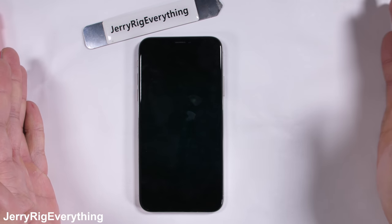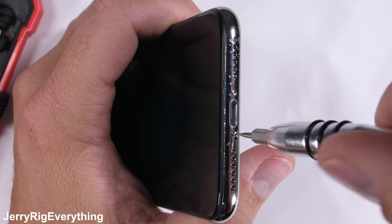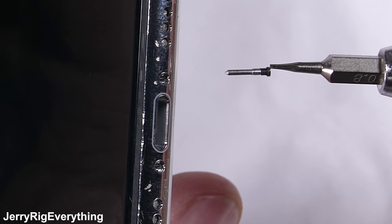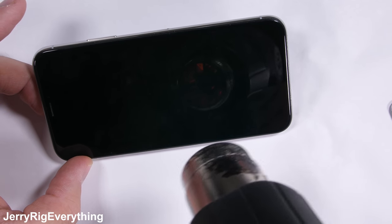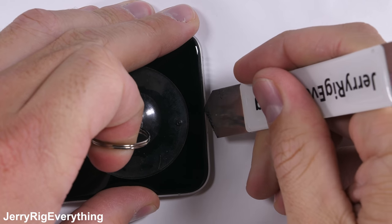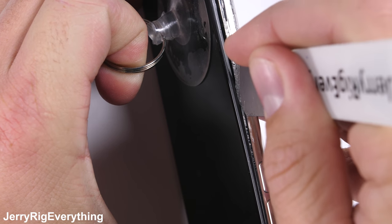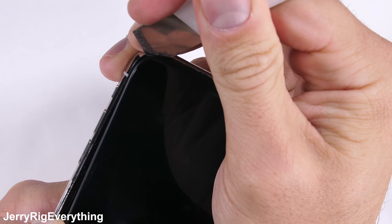Getting into this phone is pretty similar to the iPhone 7 and iPhone 8, but it does get a bit easier once you are inside. The same familiar two pentalobe screws are at the bottom of the phone. I'll have a little tool kit linked in the video description for you, along with all the parts needed to complete these replacements. After getting these two screws out, I like to warm up the screen a little by softening the IP67 water resistant adhesive under the iPhone X display. I'll use a suction cup and a pry tool to lift up on the glass a little and get my metal pry tool between the plastic edge of the screen and the metal edge of the frame. Then I can slice along the edge of the phone just underneath the glass to detach the rest of the adhesive.